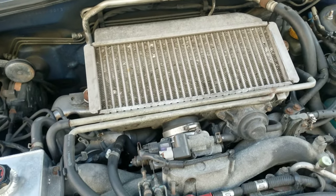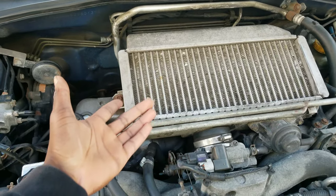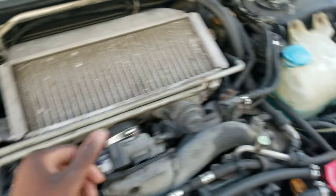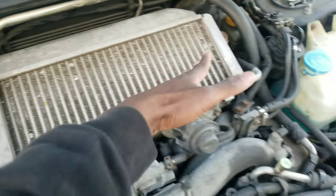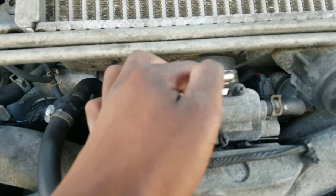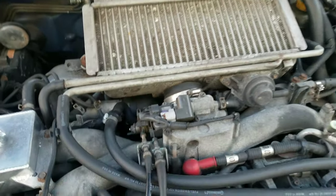Probably gonna go to map liner — if you don't know who that is, he's like infamous for tuning Subarus around here. Alright, so first thing you're gonna want to do is take off the top mount. It's the same process I showed you guys in the pitch stop mount video — you just take off the bypass valve, then take off these two nuts on the side. Also make sure you unscrew the little coupler pieces and then it'll pop right off.